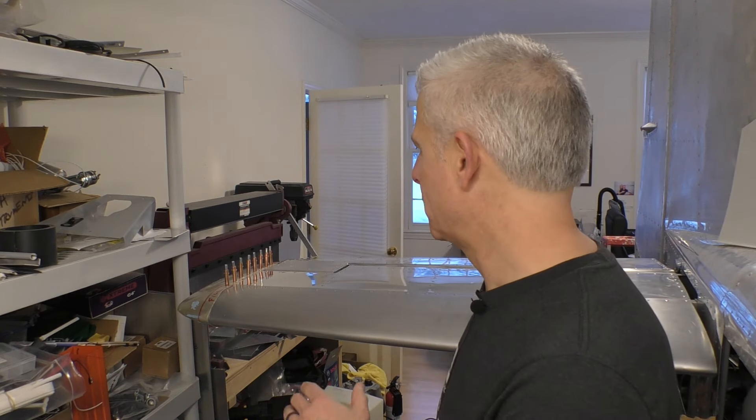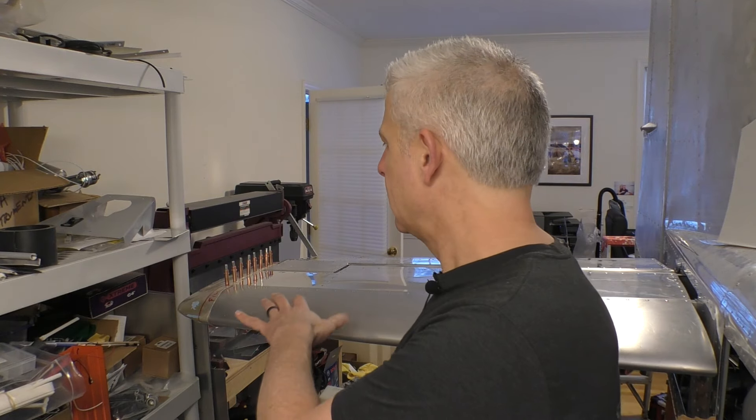The first technique that's helping us: the first thing we did was actually trim the pieces to fit. But at that point you've got a wave — a little bit of overlap where the gap just isn't what we wanted. When dealing with sheet metal, you might think about shrinking, stretching, or cutting a relief. But what we came up with that worked really well is to line the metal part of the structure with simple packing tape as a release agent, then use high-quality fiberglass with chopped fibers inside it for structural strength, and put some of that on the inside and clamp it in place.